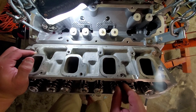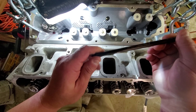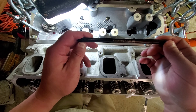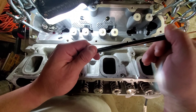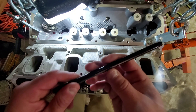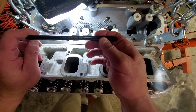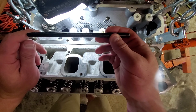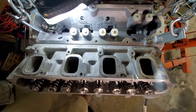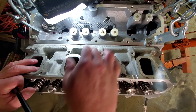That's how you check push rod length — and again I recommend doing it on all cylinders. I did that on mine. Generally you order a three-eighths push rod; standard stock length is around 7.8 inches, with Gen 5 LT4s at 7.850. Recommended wall thickness is 0.080, and they're dual-tapered push rods. The new push rods will be a tad longer but the same wall thickness and same three-eighths style.